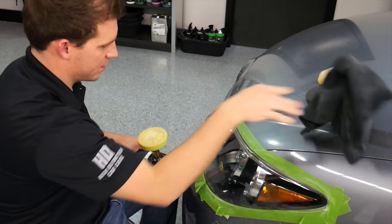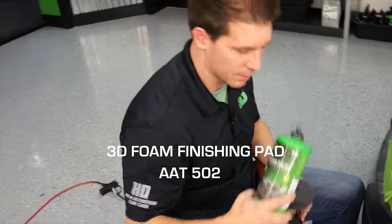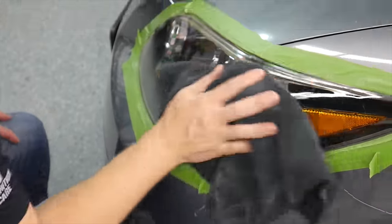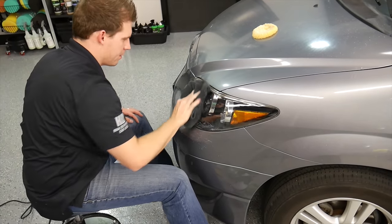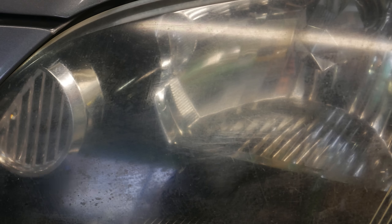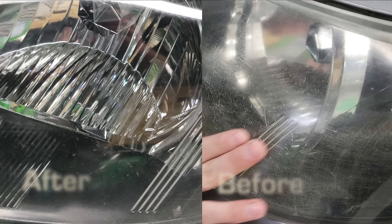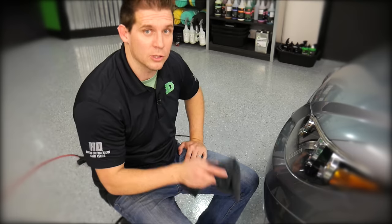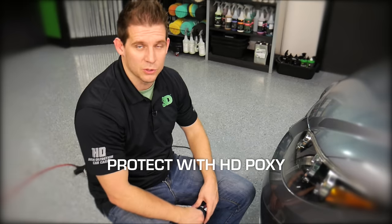As you can see, it looks pretty much finished. To get that extra pop, we're going to go with the foam finishing pad and the AAT 502. Wipe it down, pull your tape off, take your detail spray with a clean towel, and wipe from the top down. Make sure you get all of your tape residue off. And there you go — the lens is much better than it was before. Not perfect, but the lens has been worn out and there's only so much you can do. There's stuff on the inside of the lens that you won't be able to recover from, but as far as the life of this lens, we brought it back maybe another year or two. Follow this up with HD Poxy to coat it and take care of the lens with a little sacrificial layer of wax. We appreciate you checking us out — go ahead and subscribe to our channel and feel free to share us on Facebook. Talk to you soon.